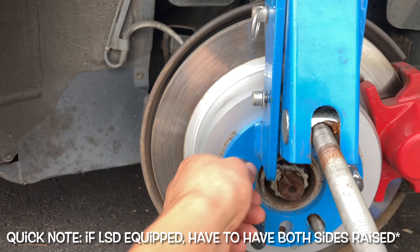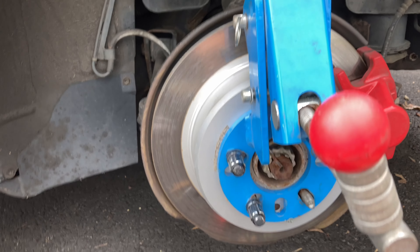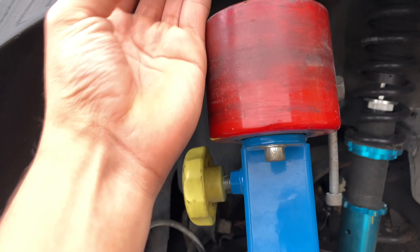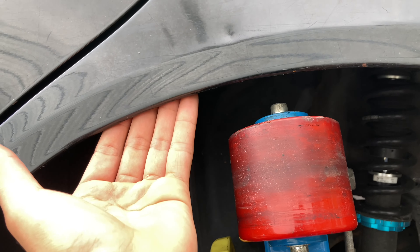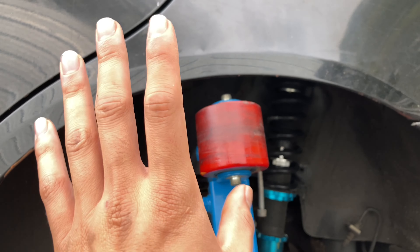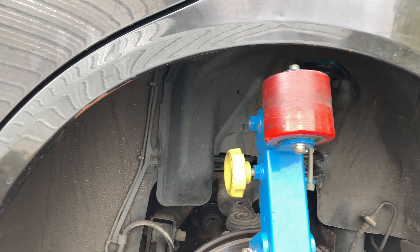I did a quick burp on the lug nuts. This knob here brings the arm forward, this one extends it up and down, and this controls the tilt. You want to get it angled properly so it starts rolling the fender lip. I'll use the heat gun to soften the metal and paint so it doesn't crack. The paint is already messed up from whoever did this last — poor job — so I'll need to do some rust prevention, but it's just surface.